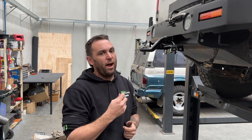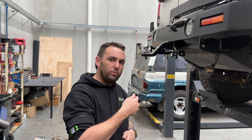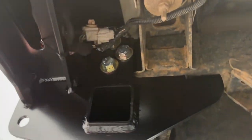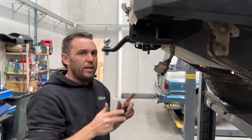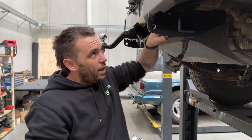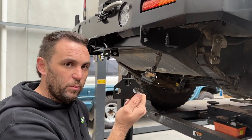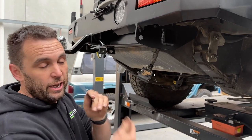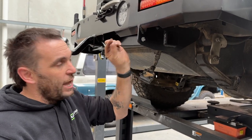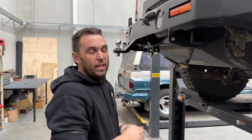Now I've slipped the bar on the car and we're going to work through bolting everything on. Start with your bolts in the side — looking up in here we've got three here. The chassis on these varies quite considerably in width, so when you sit it on, if it's quite snug that's fine. Some do have a gap, so if you've got that gap you'll put the shim in there, then put your bolts through into our little nut plate. The nut plate has a little tab that'll hang out so you can hold it with your fingers.